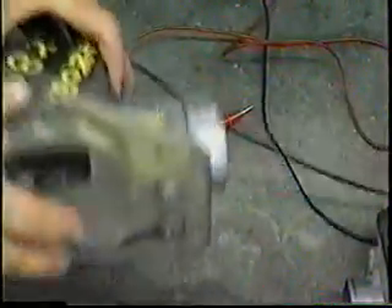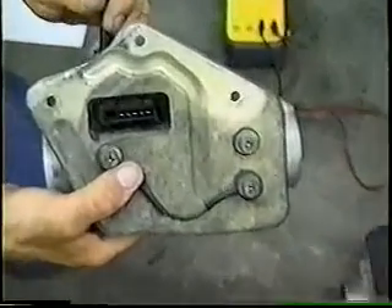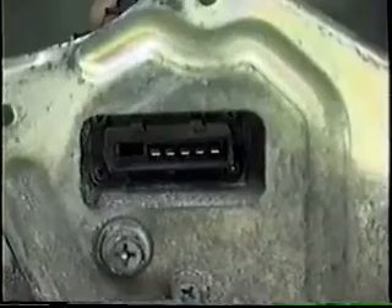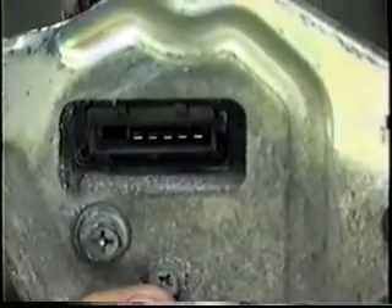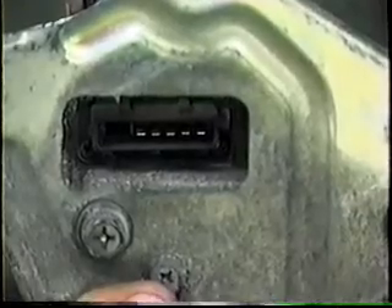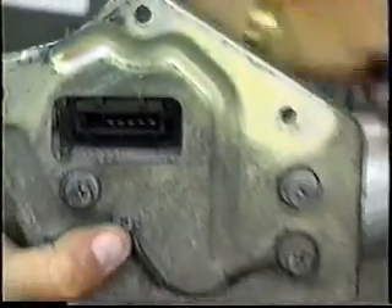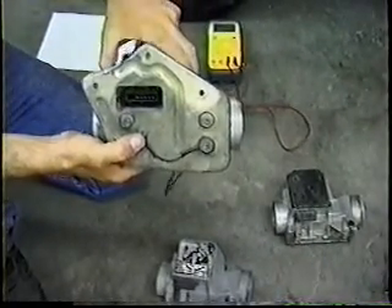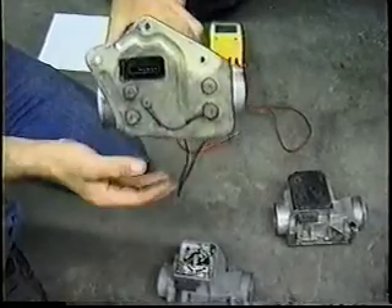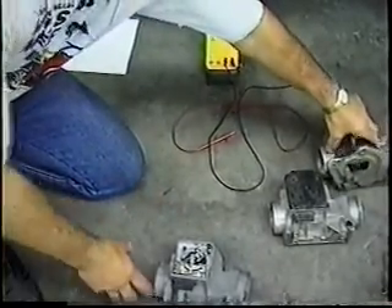This is an 11th month of 1982 ZX, and we can see right here that it only has five pins. The problem is that this system opted to use a different type of sensing to shut the fuel pump off when the car was not running — specifically a switch inside the air flow meter. The ZX uses an oil pressure sensing unit, and it's easy to tell the difference between those two.